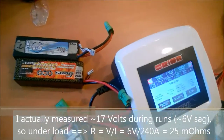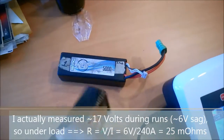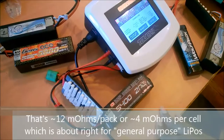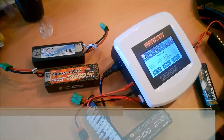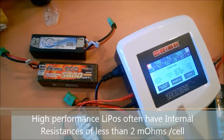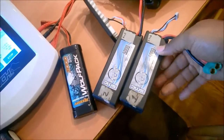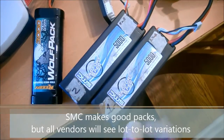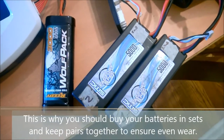Very soon I'm going to get a set of low internal resistance batteries and test them against my Gens Ace, my SMCs, and my Venom packs, so we can see what different brands typically measure and what that means in the real world. It makes a surprising amount of difference. If you have aspirations for a 100-plus mile-per-hour vehicle, something as simple as your batteries can make or break your run. Also, these are identical-appearing batteries — same series, same everything — but they were bought about six months apart, so the cells inside may even be from a different manufacturer. You can't know this performance difference unless you actually test.